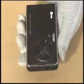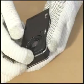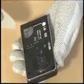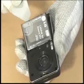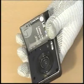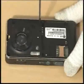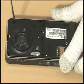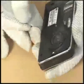Assembly and disassembly of KU 990. Remove the battery cover, then remove the battery. Remove six screws from the rear case. Remove the rear case by using a jig for disassembly.